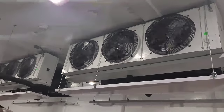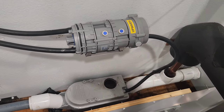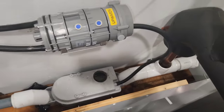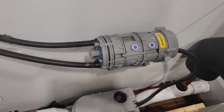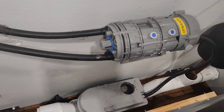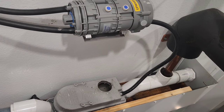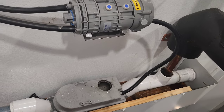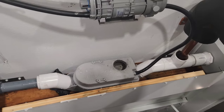To diagnose this, I forced it into a manual defrost and watched what happened. I got water spilling out of the activator — I know that's not right, water should not be here. This could only be coming from one place: the discharge hose. Once water started coming out of the activator, it stopped working and my drain started overflowing.